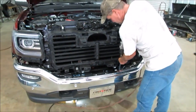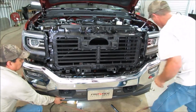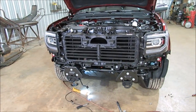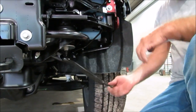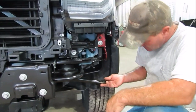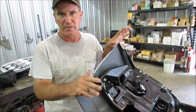I'm going to grab that other side — take that bumper and come straight off of there. I'm going to set it over here on the cart and show you the brackets. These are the side brackets right here — there's actually two bolts up underneath here. I took one completely out, loosened the other, and dropped the outside one so that bar can pivot down to get out of your way, or just take it completely off. You want to leave it on the truck. Right here is where that other end of the bracket went — it's a 15-millimeter bolt up underneath there.